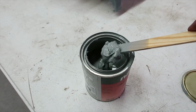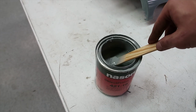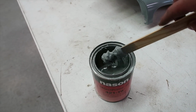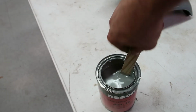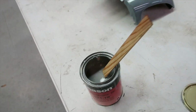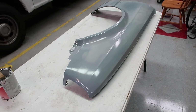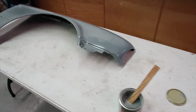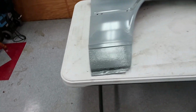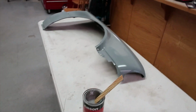Look at this, nasty. That's weird, because I figured when you open the primer and close it, it'll go into goo, but apparently it's just been sitting around too long. And like I said, I never opened it before, but this is what happened. So that's why I failed miserably in priming this fender and the sunroof cover. So we'll have to resand this all over again and reprime it. And obviously I need to go get some more primer, and let's go ahead and do that in the next video.